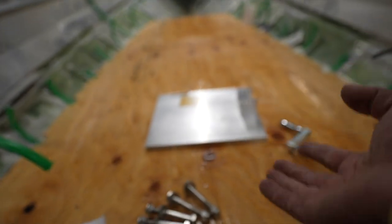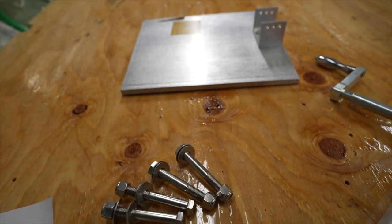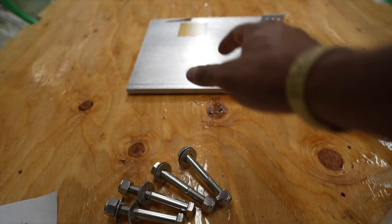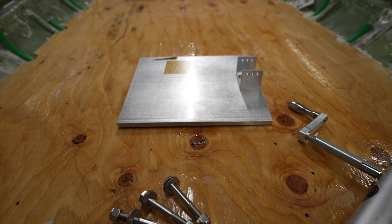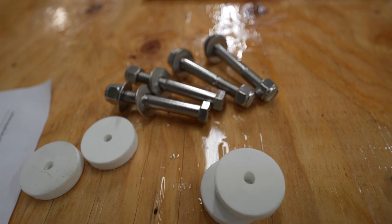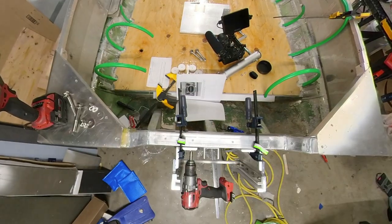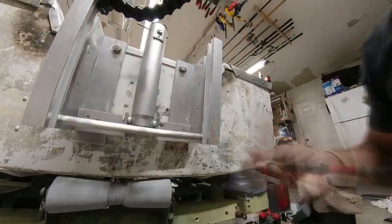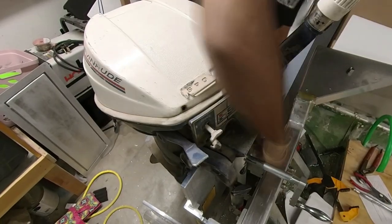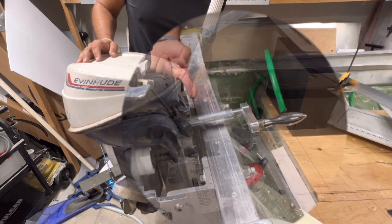Generally when you bolt the motor on, you can do two things: put extra stacks of plywood behind this to thicken it so the clamps will reach, or bolt the motor directly to the plate, which is recommended. For your clamps, they make spacers - sold separately - or you can make them out of two-by-four so your clamps aren't just dangling. Once you bolt your motor to the plate, the clamps are pretty useless but do add a little extra stiffness. Also comes with mounting hardware, which is not something a lot of jack plates come with despite how expensive they are.